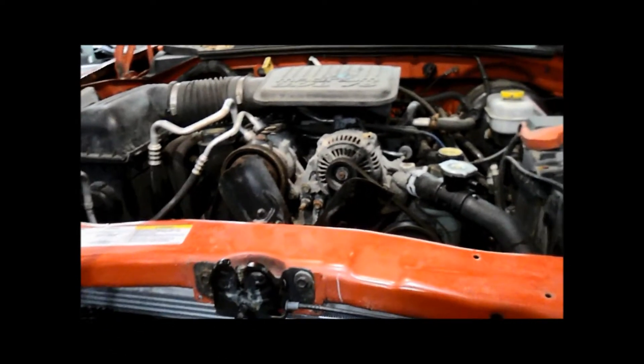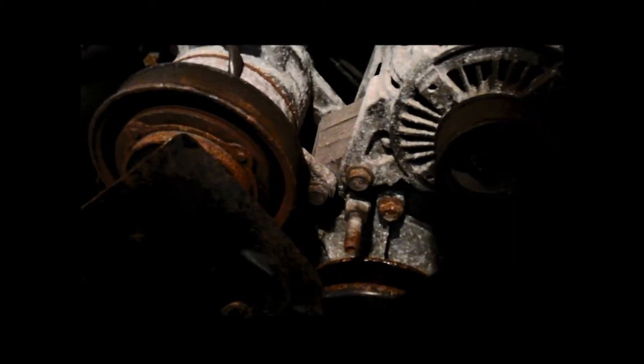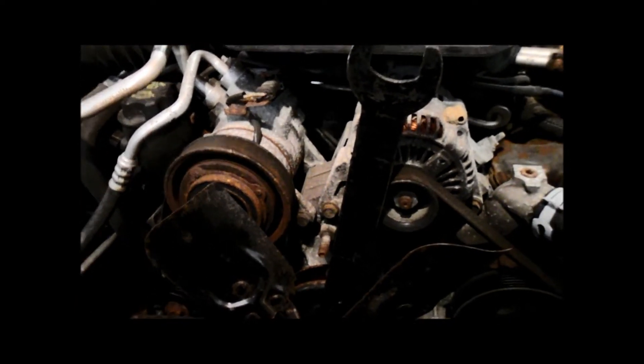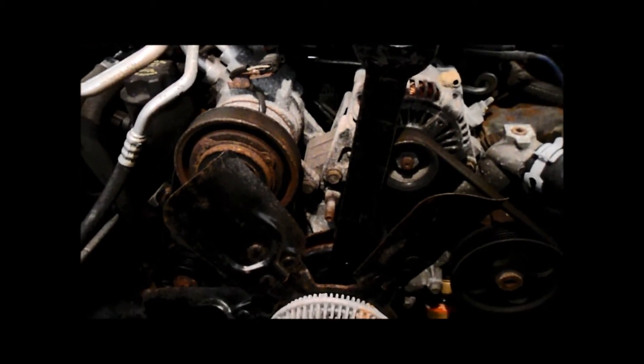I make a special tool to take this off — it's actually just a very large wrench that fits right onto the water pump here. Now if you don't have that special tool, a lot of times you can snap these loose just by using a hammer. On this 2004 Dodge — and most Dodges — you remove it left-hand, so you turn it to the left to remove it and to the right to tighten it back up. Put your wrench on here like this and I'll show you how I usually get them loose.